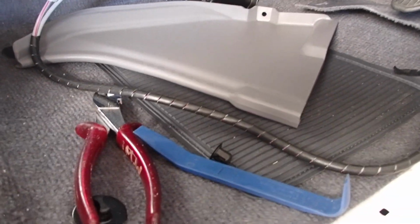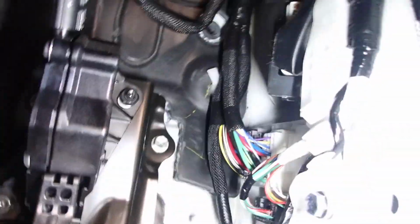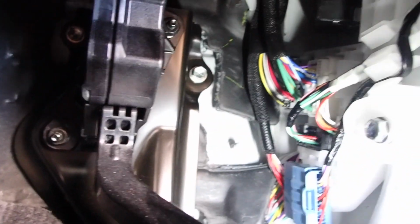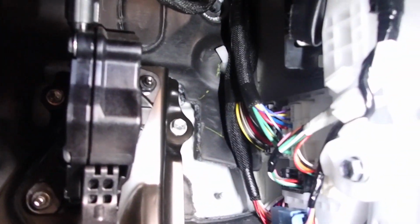Okay guys, so I have to go handheld. So I've undone this little stud. That's on the quarter panel there. So we're in here, here comes our cable up. So I'm going to tuck it up, and we're going to head for that large grommet up there. It's got 3 pre-weakened spots to pass a cable through from the other side. So we're nearly at the accessory box. So we want to make sure that this cable doesn't interfere with any wiring, especially the pedals or the fly-by-wire, and we'll keep it as neat as we can.